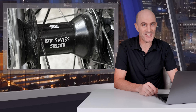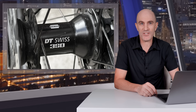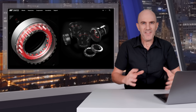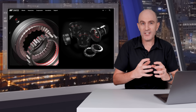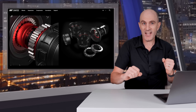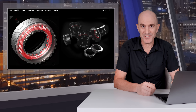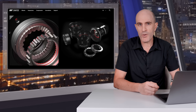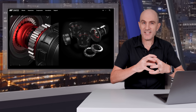Alright, you're still here? Let's roll. So in this video, I'll be referencing the DT Swiss website — it's a fantastic resource for exactly this topic, so I'll pull it up right here as we get stuck into things. Now the basics of a freehub — that tick, tick, tick sound you hear when you're not pedaling — is the freehub mechanism turning in a direction that it is freely able to do so. When you put the pedal down and tension on the chain, that freehub will engage and your rear wheel will turn and your bike will move forward. Some freehubs are loud, some are quiet, some sound like there's an angry swarm of bees just a few feet from your butt. But when you start pedaling, everything locks into place and shuts up.